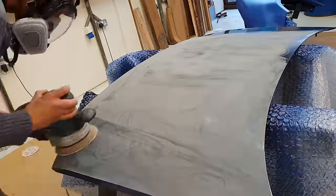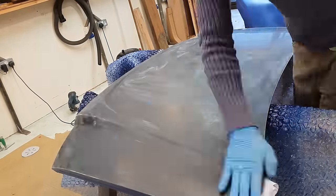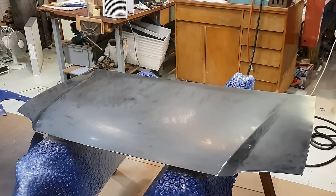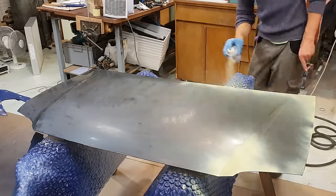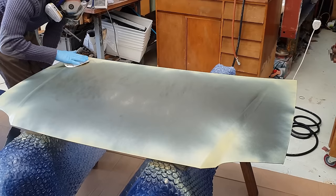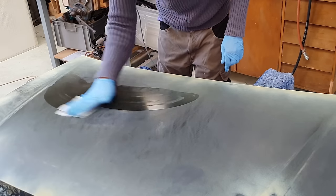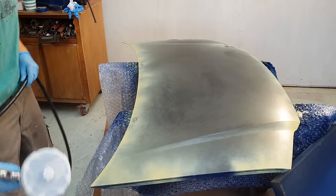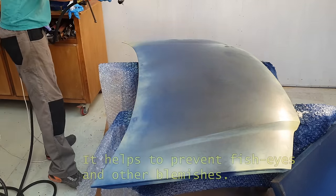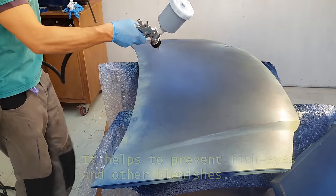If we say part two of this mistake was ploughing on and doing that extra coat, part three of the mistake was that I didn't actually do a proper first coat. The first coat is supposed to be a 0.5 of a coat. I expect and hope some of you are going to tell me the various wrongs or rights of that, but as I understand it, this is a very thin coat that's sprayed from a bit further away than a normal one, a sort of dusting that just provides the water-based paint with a good foundation for the next coat that goes on a lot more thickly.